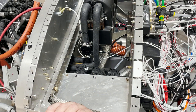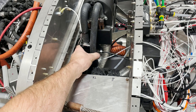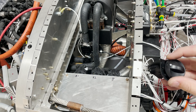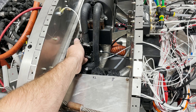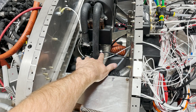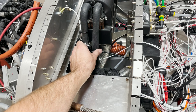The next step is to wire your heater cable — this is the cable that adjusts how much coolant goes through your heater. Clip it in with this clip here. The best way is to take your heater switch, put it all the way to the off position, which is rotating it all the way to the left. When you make your connection to the bottom hole on the heater arm, push the cable with the switch in the off position all the way to the left, push the lever all the way forward to the front of the plane, and then clip the tube in where it rests. That way you know that when the switch is all the way off, you are fully shutting that valve.